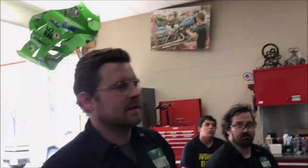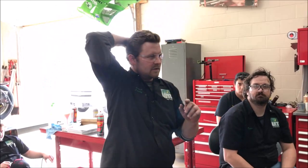Let's do a summary. Where people get confused is if you look up the torque spec for the top triple tree nut without the torque procedure for the steering stem, there's no way to set everything correctly. The manual says torque it to 32.5, rotate it four or five times to allow the bearings to settle — that's actually printed in there from Suzuki — then loosen it a quarter to half turn depending on how you want the front end. That's why wheelies and hard riding causes it to come loose, and why this maintenance procedure is heavily overlooked. Most of the time customers come in to replace the bearings, not to take it apart, grease it, and re-torque it. If it's probably broken, keep wrenching.